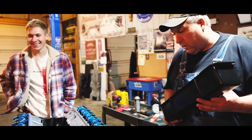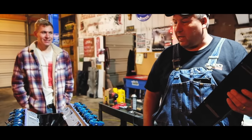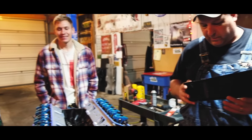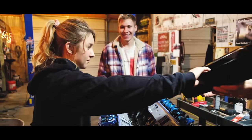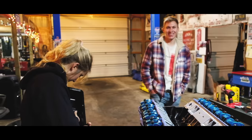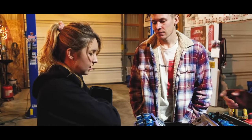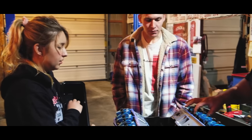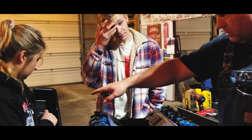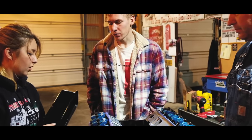What a massacre. I hate doing it. Because what I do is I take it in my hand, I take a hammer, bam, and knock them out. And generally it warps the valve cover, but she's like, give it to me. Are you recording that? So, why do you have to take these out? Well, sometimes they don't fit between the rocker arms. So it fits, and I didn't see that it has those holes to let the oil come down through easy, so they should be all right. Usually they don't have those holes.